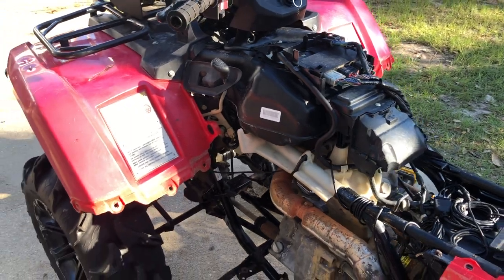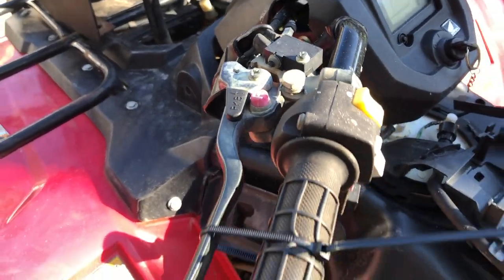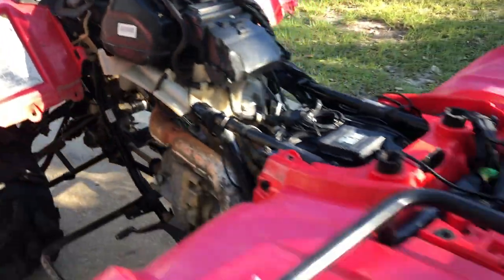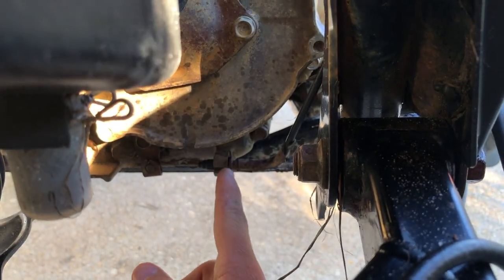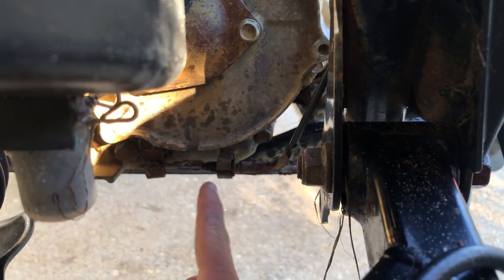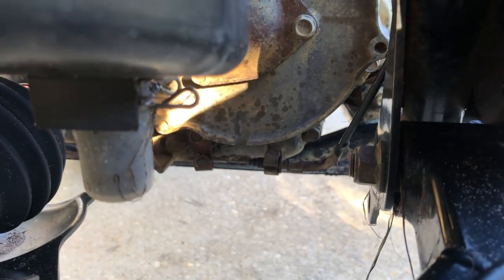If you're doing the reverse zip-tying on your own, you can put it in reverse, zip tie the lever, and then come up under the bike. All you're going to do is zip tie it right here — just zip tie that shut. Then you can pull your cable out, or if you want to keep the cable, you can do that.